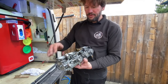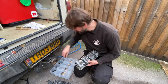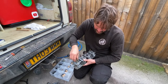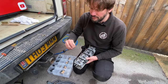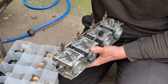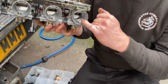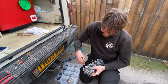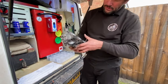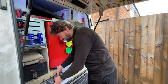So we pop the pilot jet back into the carburettor and seat it down. Then the main jet and emulsion tube — screw them in. Normally there's a 7mm or 8mm spanner on those ones. Just nip it with a decent fitting screwdriver — just want to nip that, and there we go. That carb is done. But I made a mistake — there was a little brass insert piece. This is why we have everything laid out. That little brass insert piece needs to go underneath the emulsion tube — large end in first, smaller end up towards you. Pop it in, and then the emulsion tube goes in. So we messed up there, but that's all the jets back into their respective holes.